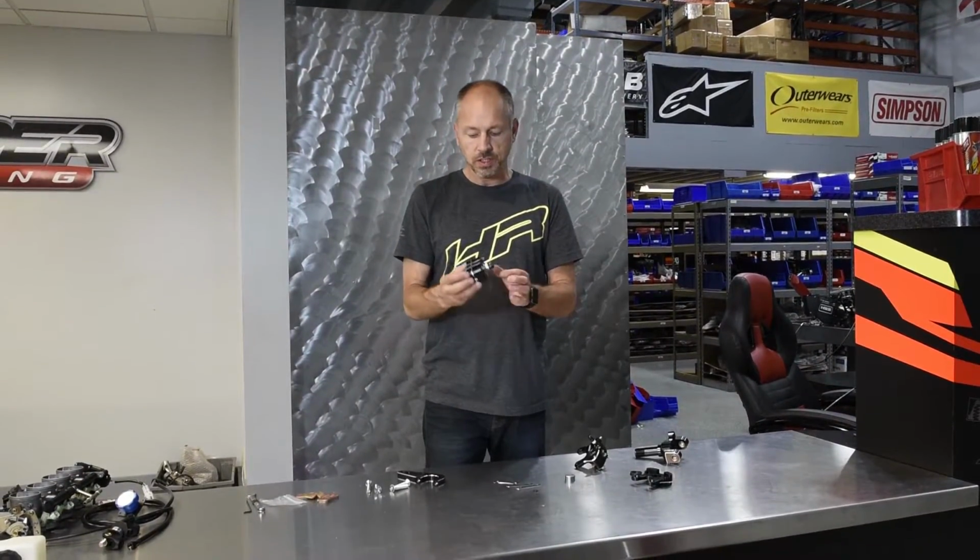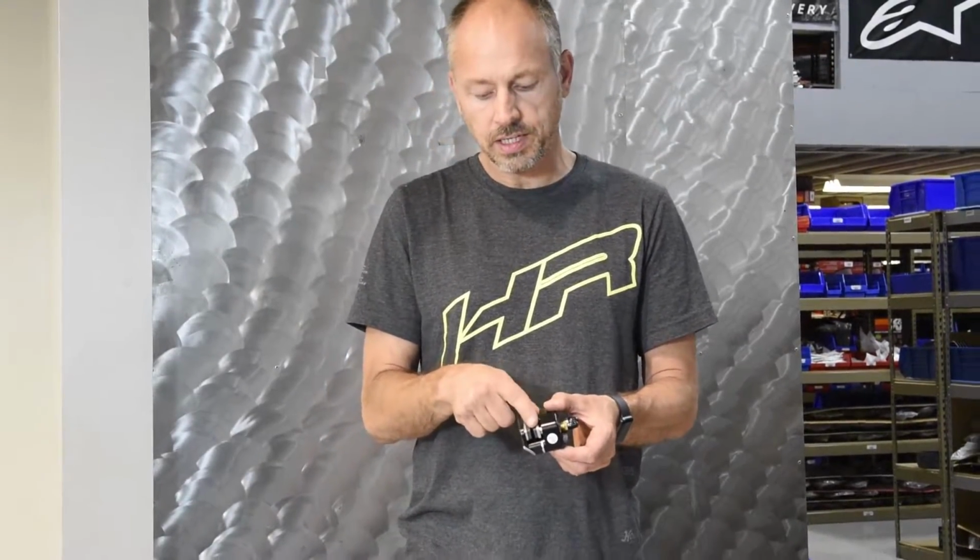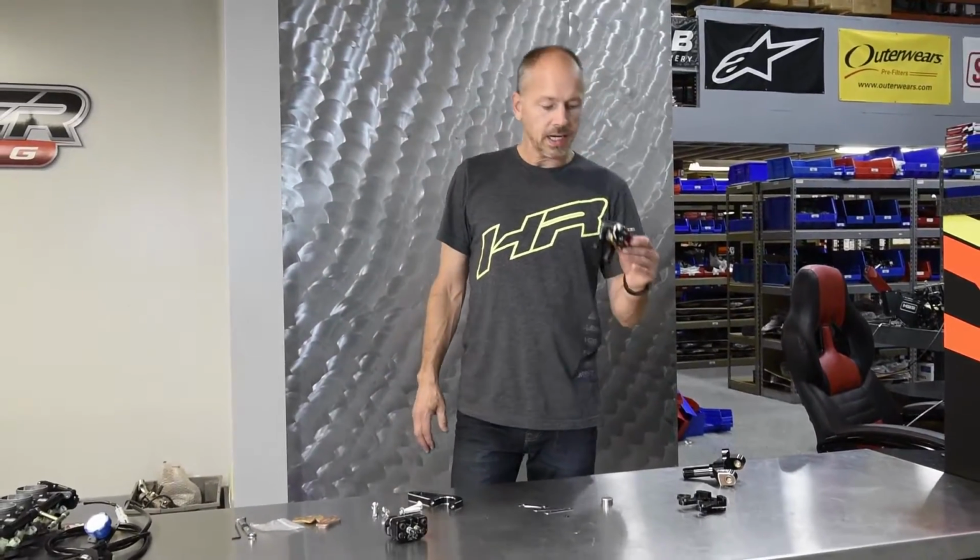And the screws, so this was always held on with a bracket that bolted onto the spindle. The screws went into here. There's only 3 threads holding the screw into the pad, and so those were constantly coming loose and coming out. The whole thing would fall apart. I'd drop out of a race. So out of necessity, I designed this.